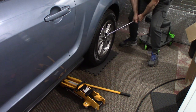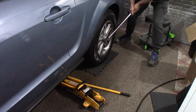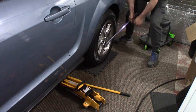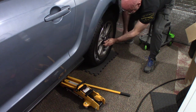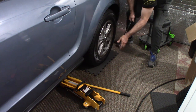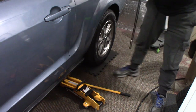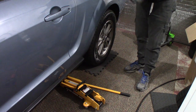and break the bolt here. And you can do it pretty quickly, because if it's in too much, you will have problems with stripping. So this way you're in total control. I think this one's loose. Yeah, check that one first. Okay, so now that they're loose, let me get my gloves on and we're gonna get the jack up.